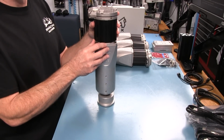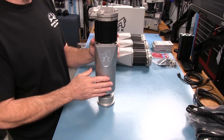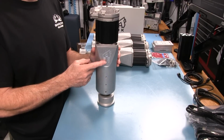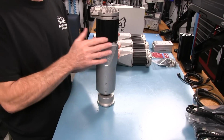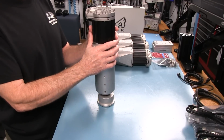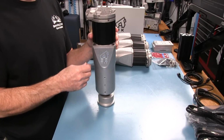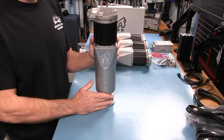So even though the peak is not as much, the RMS is about a third more or so, right? And it would take more power to deliver the capacity that they're claiming on these, which means a set of 4 of these actuators will do 800 pounds. So that's the max you can reach with cockpit and driver and accessories before you're going above the optimal parameters as far as operating windows for these motors and this actuator system.